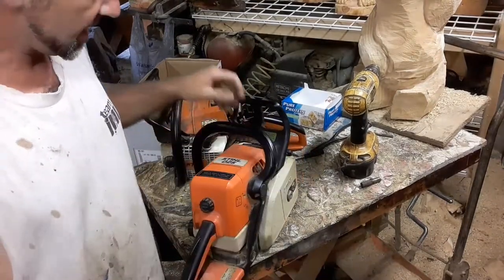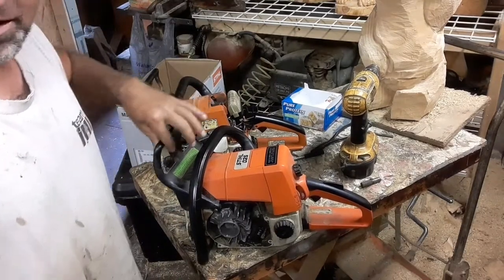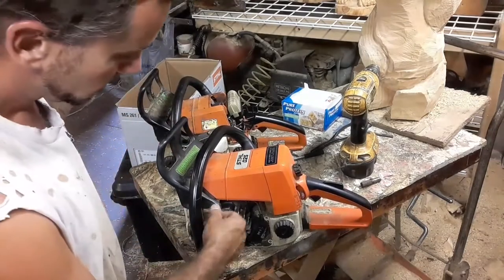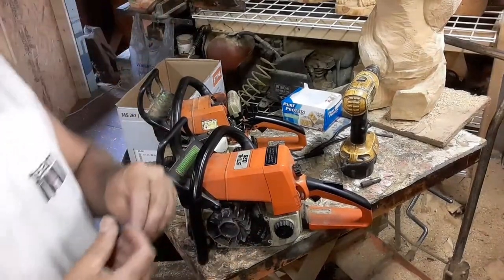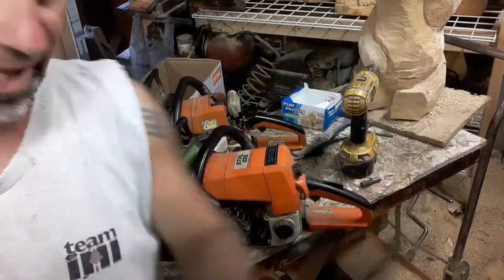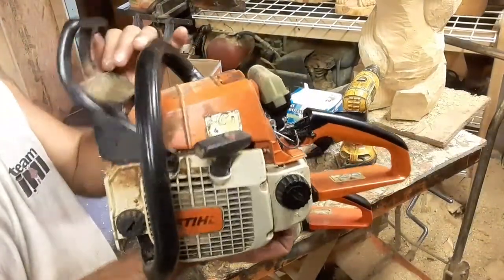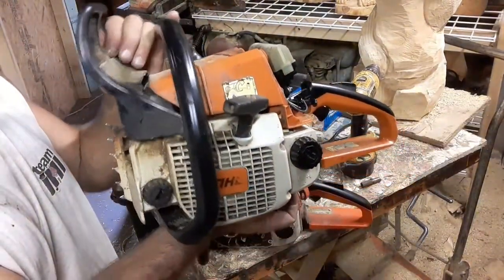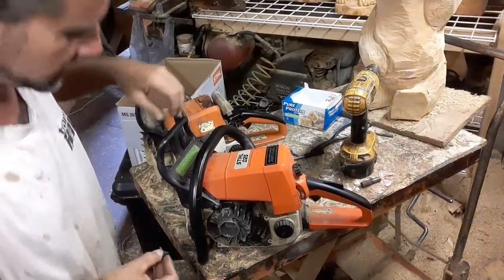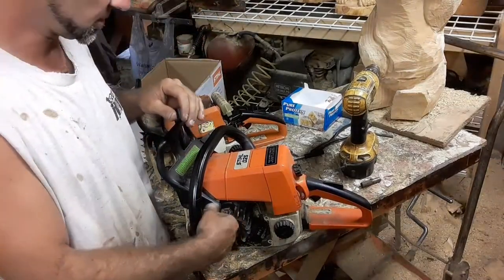The other thing to check, very important to check, there is a bolt here with a little saddle washer. If you lose that bolt in that saddle washer, like I did on this saw, and that's, I mean, when you're running that saw, man, that thing is gonna shake the crap out of your saw. It's going to make it feel like something is really wrong.